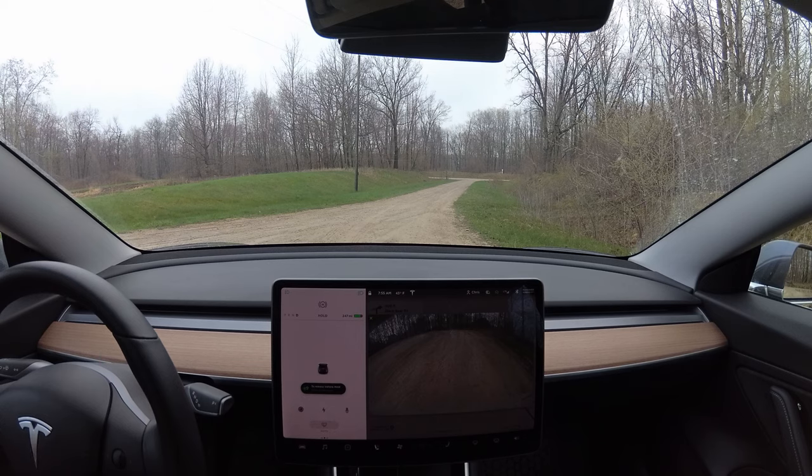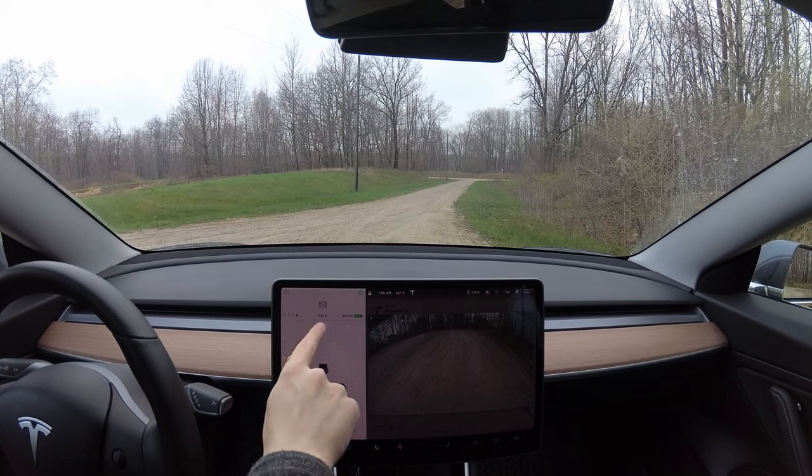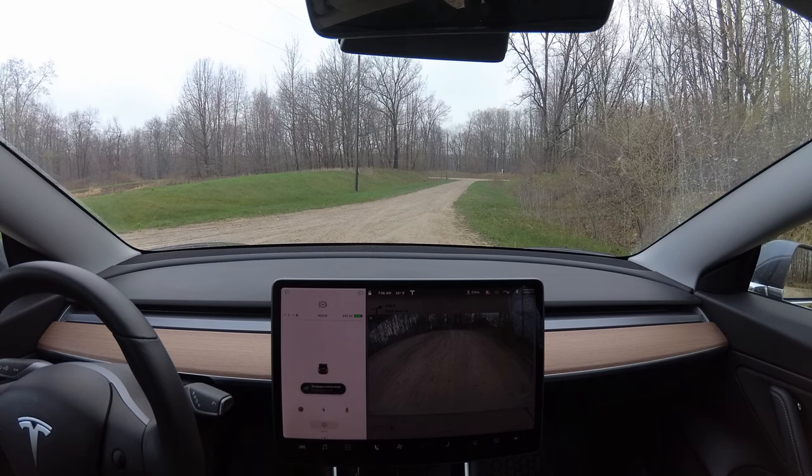Temperature is a lot more variable and that's why I started early in the morning. So I can show you here — these dotted lines are my limited regen, so I can only regen to here. The regen starts in the middle. You'll see the green going this way is me gaining energy, and if it goes this way the black means I'm using energy.